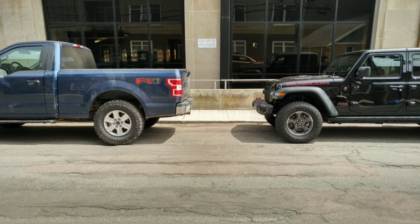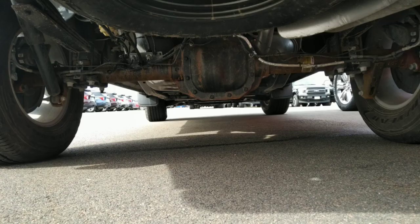The 8.8-inch axle has some benefits — it's lighter, more fuel efficient, and gives you a little more ground clearance. It's very strong, plenty strong enough to run 35s. But the weight rating of 3,800 pounds means most of these trucks max out at 3,800 pounds, so changing tires might change your front axle rating, but it's not going to change your back axle rating — because 3,800 is as high as it goes.